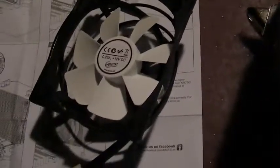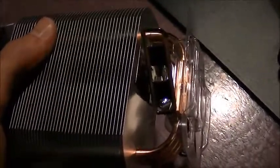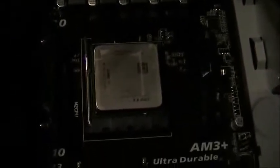I'll be right back. So the top side went on, started pretty easily, but for this side you actually will have to unclip the fan from the heatsink. Now that I have successfully unsnapped the fan from the heatsink just by applying some pressure outward on that clip, I can now start the next bracket. Now that I have them both started, I'm going to remove the plastic that I put back on the bottom in order for it to be outside of the case and keep the thermal contact intact. So next I'm going to remove the plastic piece and see how the brackets fit onto the heatsink mount.